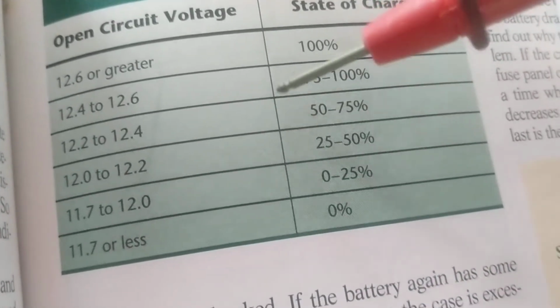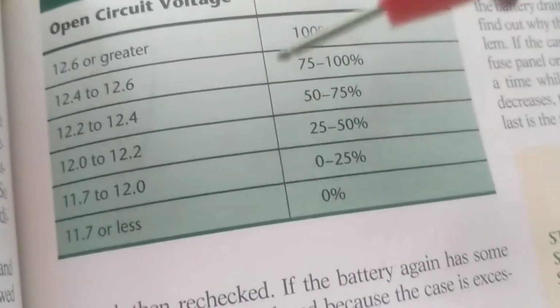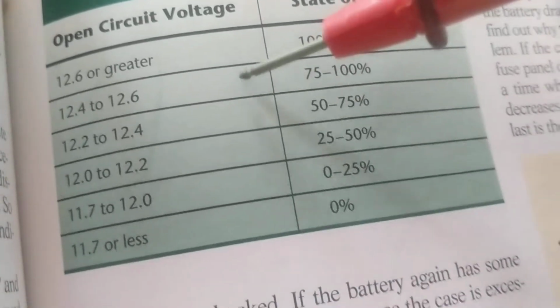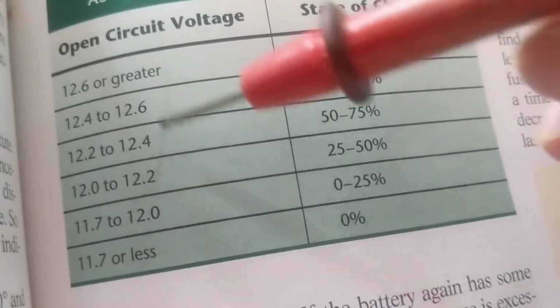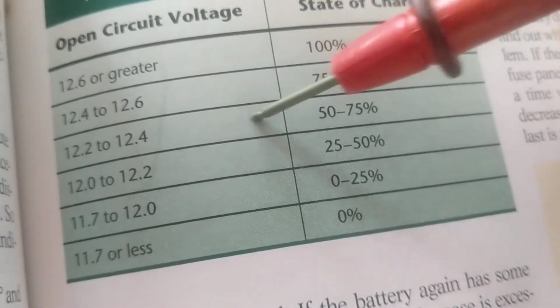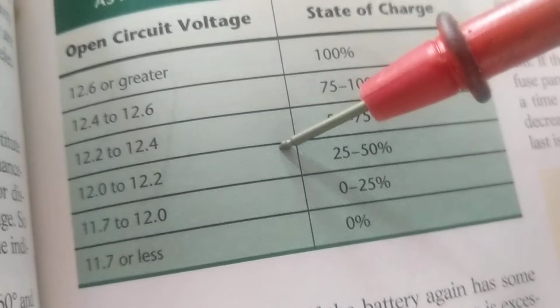You're going to buy a Harbor Freight meter. You think you're going to detect that? That's why you use these meters that are high input impedance. And you can always put on millivolts. When it is very close, 0.2 volts, I could put it on millivolt scale and measure the difference. But what I'm saying is that on a 40 degree day, a 30 degree day, you're going to go less and less and less.